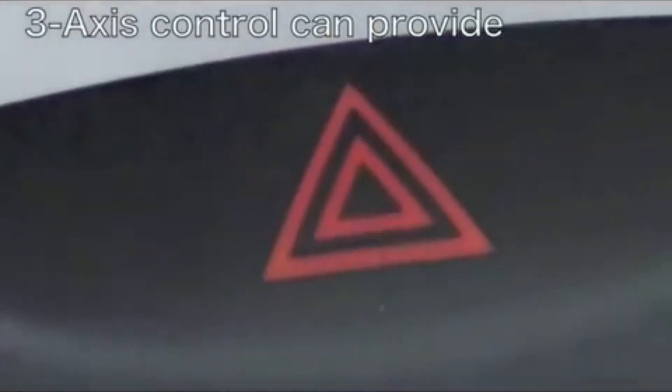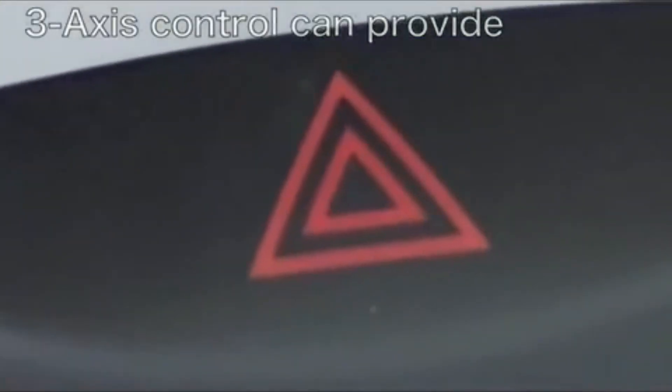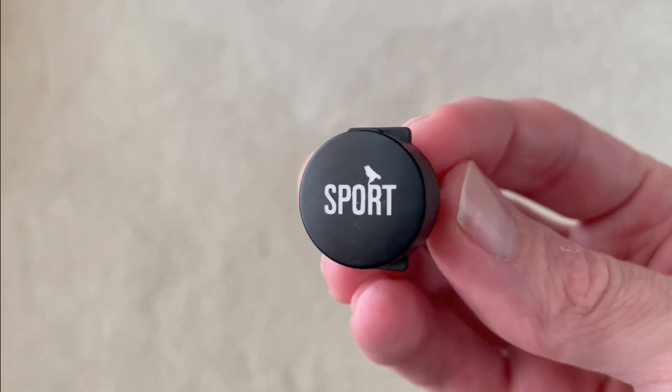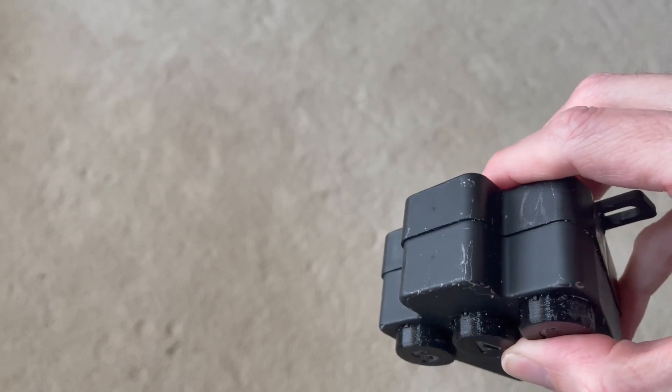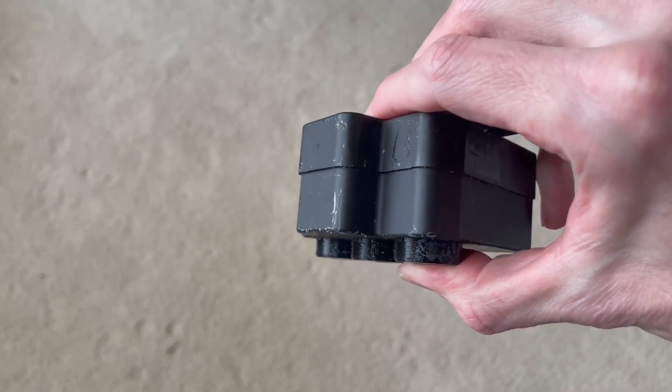A laser etching machine, or similar, was then used to remove the paint of the letters, meaning that the letters are the bare plastic. After this, a clear coat of some type was applied, which is what gums up over time. Here you can see Lamborghini applied the clear coat to the entire button assembly, which is a terrible mess ten years later.